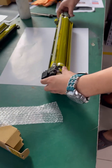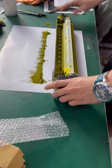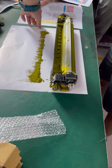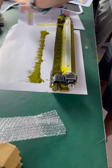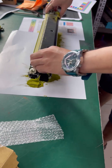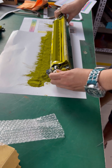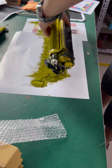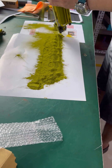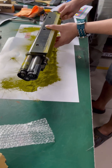We removed the developer unit. As you can see, we took out the cover and we just put a piece of paper on the table. The whole idea here is to empty the unit of the developer powder so we can vacuum it out and clean it.